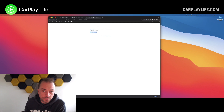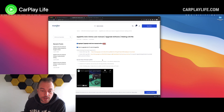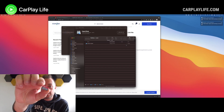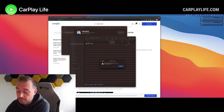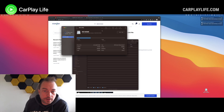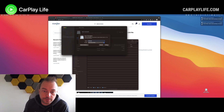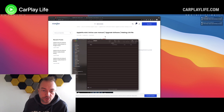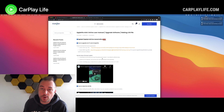That's now going to download to our drive and we're going to switch back whilst that's downloading. That's 1.3 gig — that's quite a lot. So we need to download the firmware and put it onto a TF card. We've got an SD card here — this is a SanDisk Ultra 32 gig. First things first, we need to format this card and erase it. Let's call it update FAT32. So that's done. We need to copy the update zip file — we don't need to extract it.